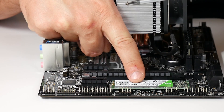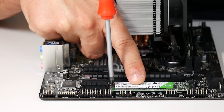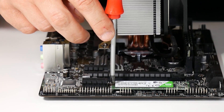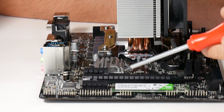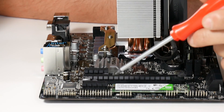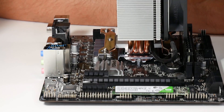Apply a little bit of pressure onto the drive and then gently screw the screw into the mounting point. Don't over-tighten it because you will damage the drive — it is only a printed circuit board with no protection. As soon as you feel it snugly pinching, stop. You're done.